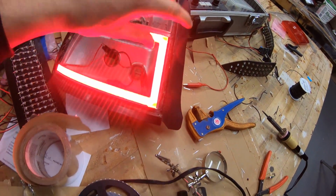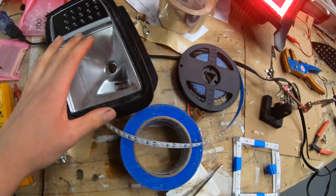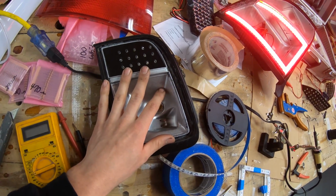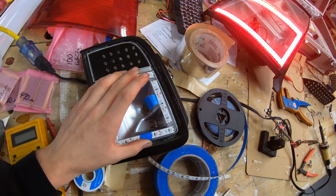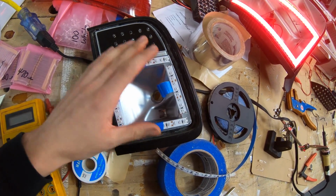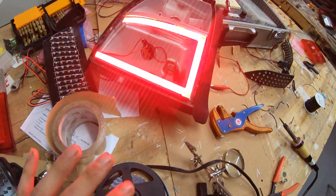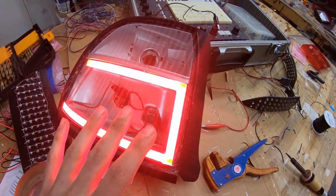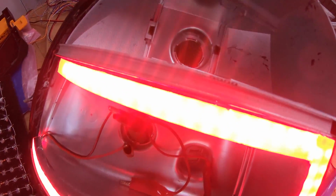Like I said, this one I'm still soldering, and then I'll glue it to the back side of this to go in here, and then those guys will light up. You can see it fits just like this. So I'll be putting it on the back side of the plexiglass, and the plexiglass is sanded, so it does kind of diffuse and obscure the light a little bit, so it helps to make it not look like individual LEDs, but you guys probably can't tell.